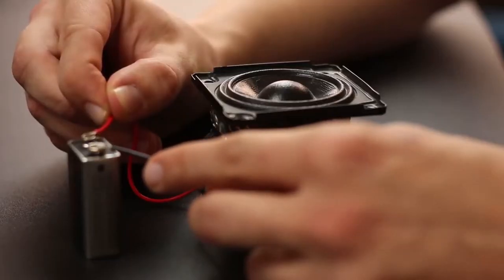There are two ways you can test it. One is by using a digital ohm meter, or a 9-volt battery. With the 9-volt battery method, on these particular Bose systems they have the terminals one on each side, but on a regular one they're right there together. You just touch the two terminals with the battery — polarity doesn't matter. If the voice coil is still good, it will actually pop and the speaker will physically go in or out. You can physically see and feel the speaker pop.